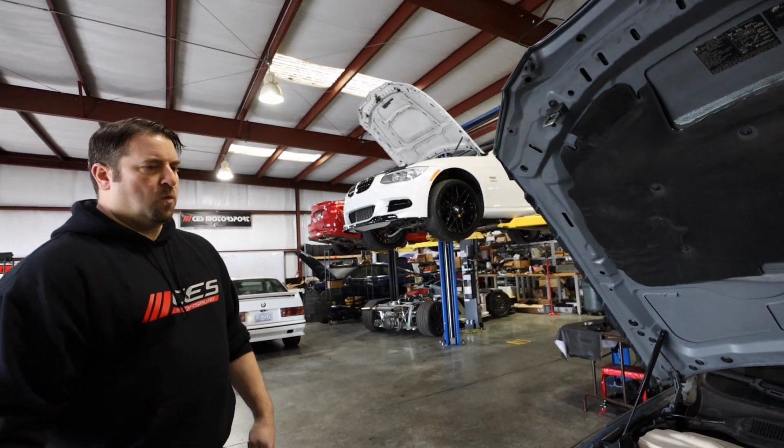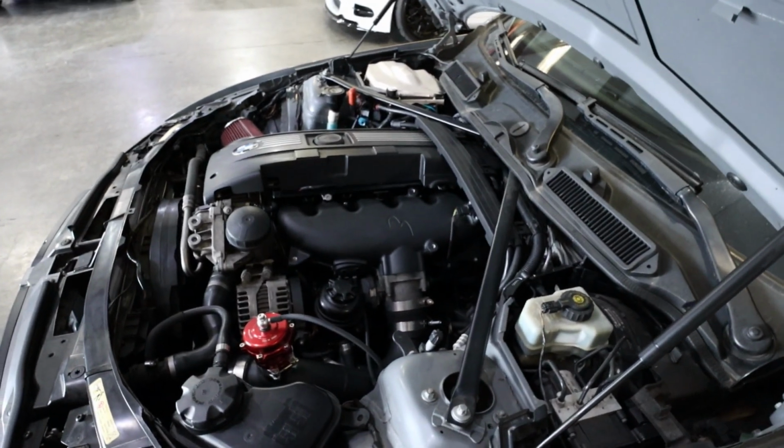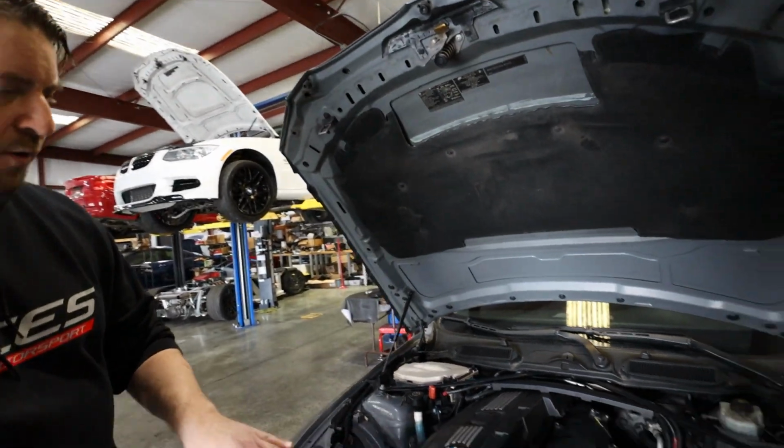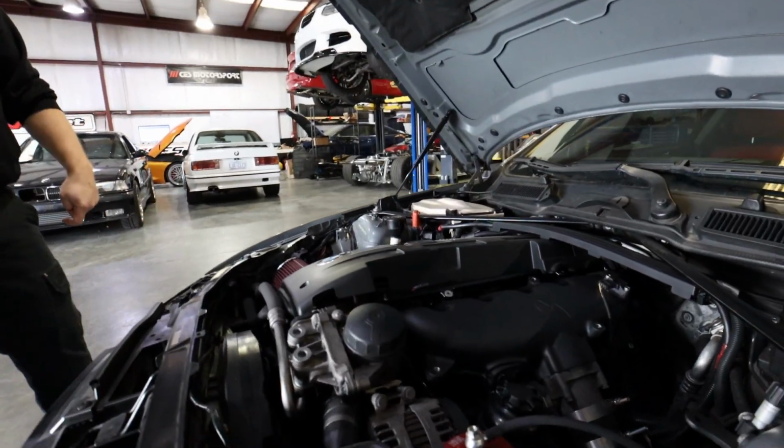So this particular one has a single low pressure fuel pump upgrade. It does have the EOSpeed manifold. We do a lot of work with Mike. We love his design. The fit and finish of these intake manifolds is absolutely amazing. It has wonderful PI rail for 750cc injectors, which is what we're running on this car. This was a full E85 tuned car.